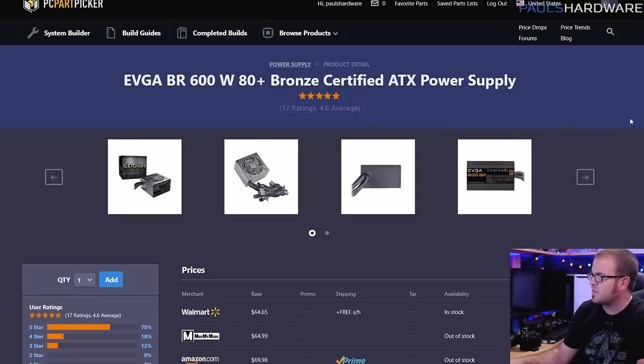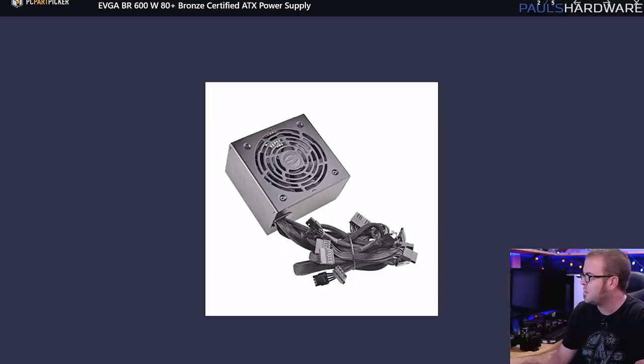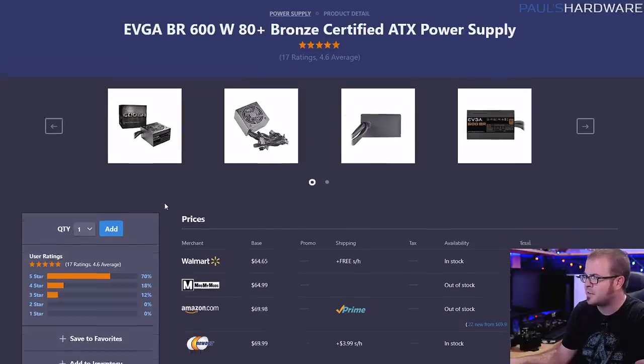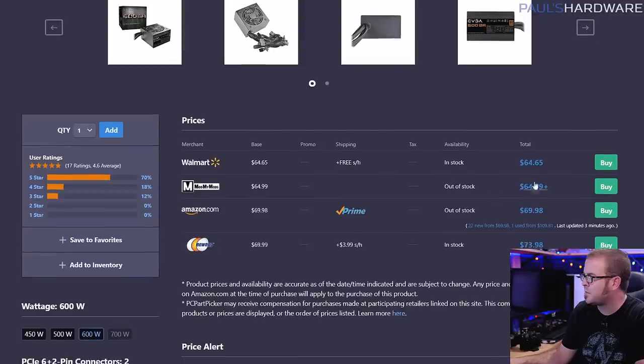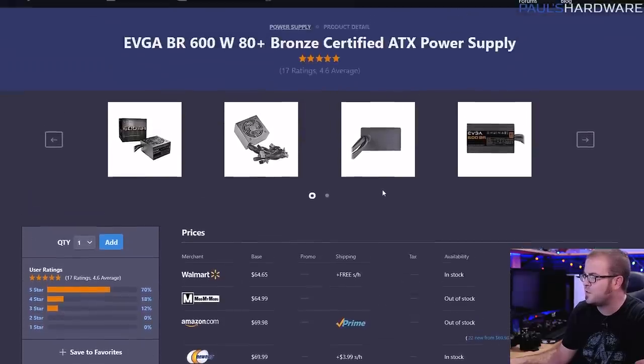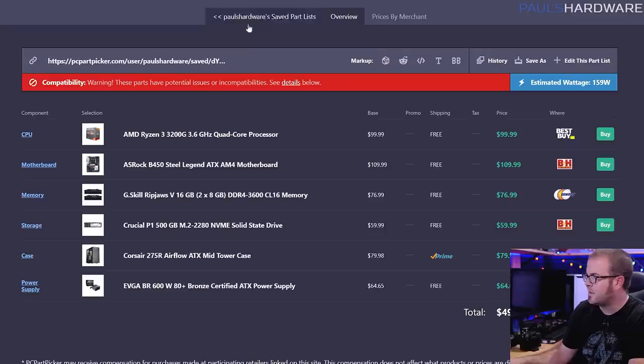Power supplies are still a little bit hard to come by, but a little bit more accessible. What you're going to want is a 550-watt power supply — maybe go for a 600 or 650-watt option. 80 Plus Bronze certified at least; go for 80 Plus Gold if you can, but those will cost quite a bit more. Standard ATX, of course. Ideally you want a power supply with all-black cables, as they blend in much better than the ketchup and mustard cables that cheap supplies often use. Having a modular or partially modular power supply is also nice. So for $65, available from a couple of retailers, look for those qualifications: 550 to 650 watts, 80 Plus Bronze, possibly modular, all-black cables, and go for an EVGA, Corsair, or Seasonic.